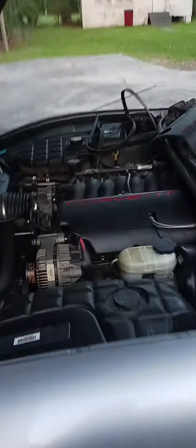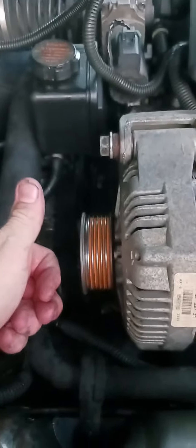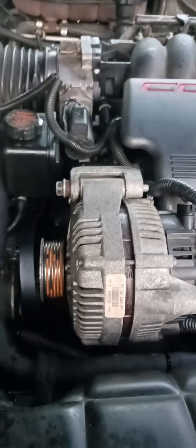I'm going to leave it running. I'm going to get an alternator tomorrow, put it on, and get her buttoned up. What it was — this thing was caked with oil and you couldn't hear it. When I cleaned it out, you can hear it. It roars loud too, and it's not charging. The charging system is going into limp mode, getting a reading from the computer. I'm going to put a new one on it tomorrow. We'll put the new belt back on it. This will be completed.